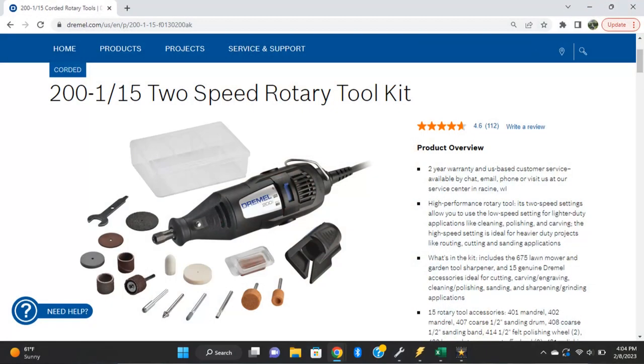This next one is what you're going to use to cut the windshield. I've seen a lot of different recommendations. This was my first time doing the mod, first time I've ever messed with acrylic — I was very apprehensive about it for the last year or two. Yesterday I finally got it in me to cut it. What I found works best, at least for me, is a Dremel 200 with a cutoff wheel. You'll also need 120-grit sandpaper.